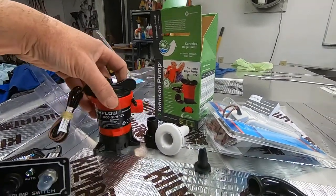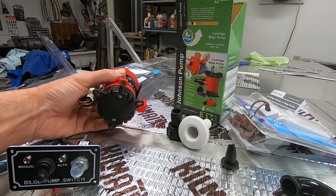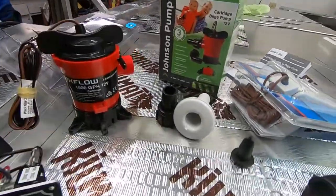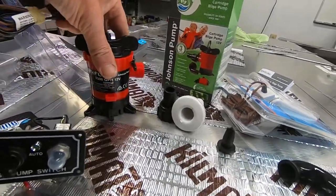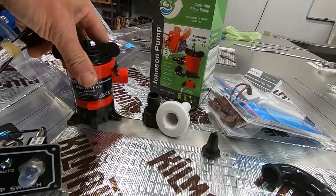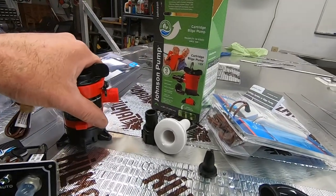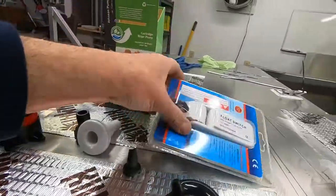Hopefully I won't have to use it that much, but I also needed something with a small footprint. I know it's about the amount of space I've got in the very back center between the intake and the engine bearers. I'm trying to get it as far back to center as I can. I might not be able to mount it perfectly — it might just be sitting in there — but I'd like to secure it somehow so it's not flopping around, maybe by using the hose connection under tension to create downward pressure. I'll go with a heavier braided clear PVC hose and run it up to the bung.